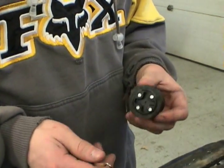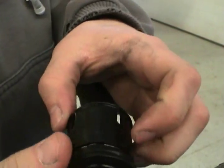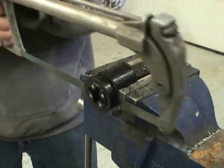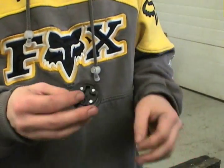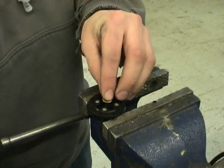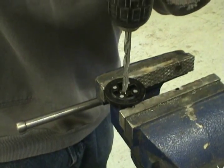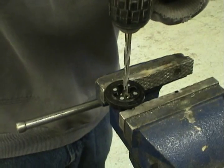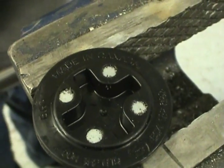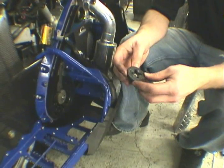After removing the stock magnetic plug for the speed sensor, take off the O-ring. Now we're going to cut it along this O-ring groove with the hacksaw, then clean up the edges with the sander. To drill the hole to mount the modified speed sensor, the first step is inserting the quarter-inch washer right into the center, then using a quarter-inch drill bit just to start the hole. We're using the washer to locate the center so the hole is perfectly in the middle. Now switch to the 3/16-inch bit and drill through.